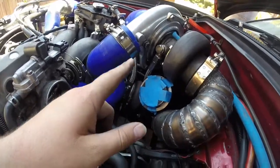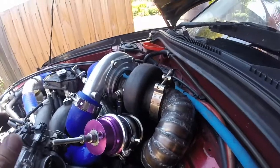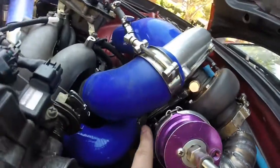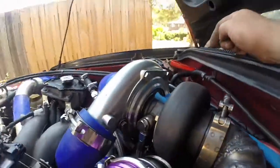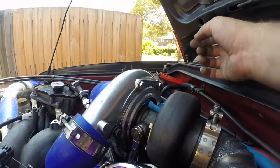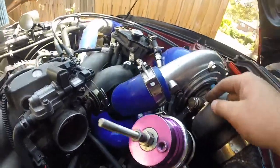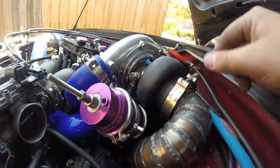Wastegate is about to go on — I'm going to do it right now guys. Alright, got the wastegate just sitting on there. This section pulls the spring up so the plunger comes up so it can be bolted on. I'm going to change this nipple over to the other side — you guys know why? It's too freaking hot over here. I've actually got it over here but I could probably change it to there. These all go through into the compressor housing just to make that path a bit smaller. This wastegate — I think it's got a 5 PSI spring in it. We'll see if that clamp fits on, if not this is going to be fun.